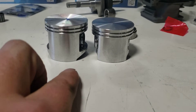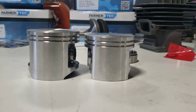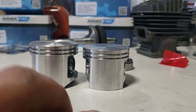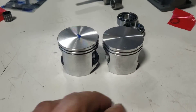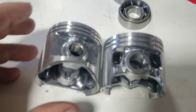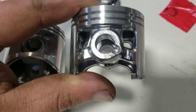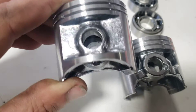Here you have the Husky — these are Farmer Tech copies. First off, look at that: there's a height difference that's going to have to be addressed if you want to swap them. Nowadays they're so cheap, just buy the right one. The Stihl piston is windowed — you can see those holes all the way through — so it's definitely lighter. The Husqvarna one is not windowed, so it's going to be heavier.